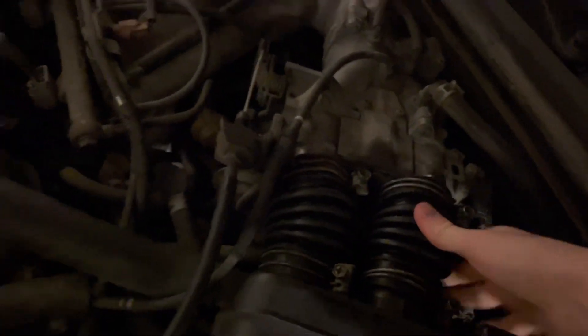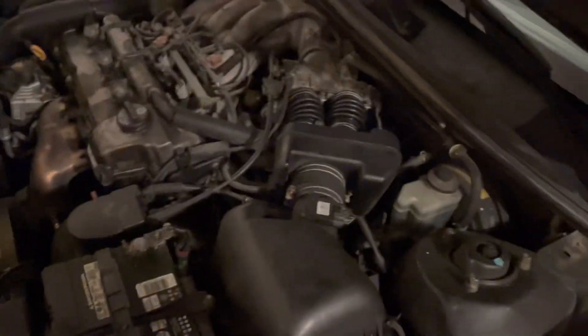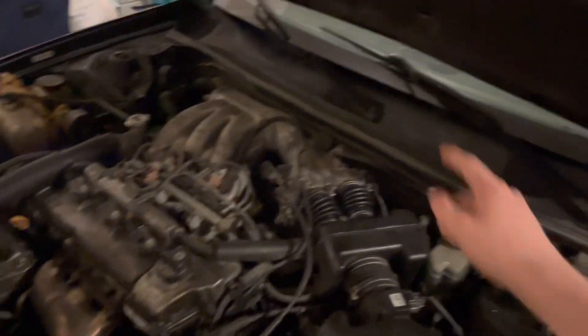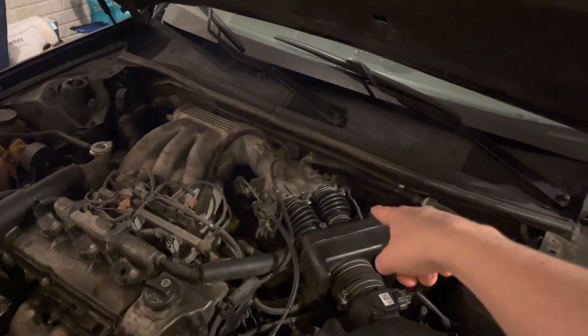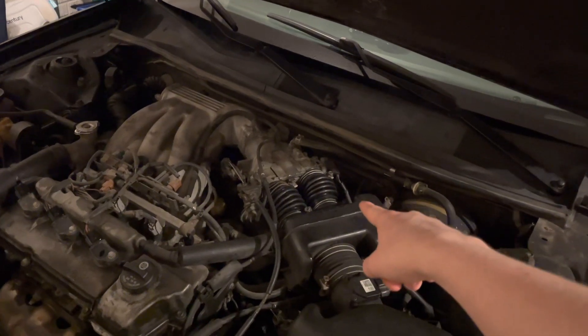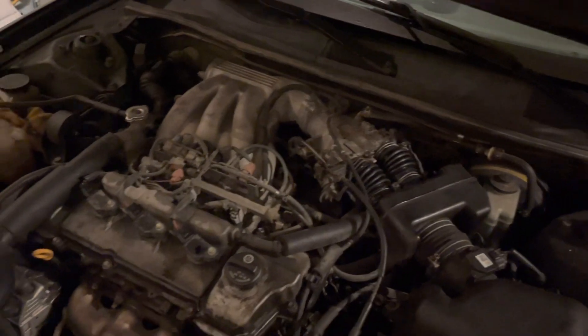This one's a little lopsided, but it's still on there pretty good. I used the old hose clamps because it didn't come with new ones. But as you can see, replaced that, so now it can actually breathe filtered air. That also — when those were on there — it got the idle control valve dirty, so cold starts, it would die. So I cleaned that up and it's doing fine now.